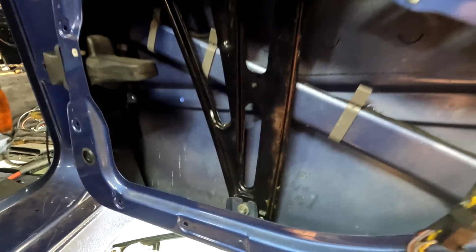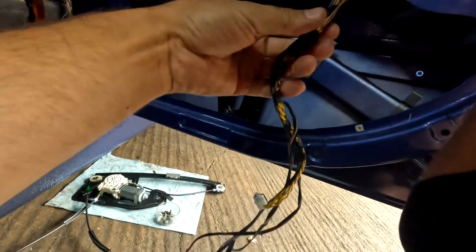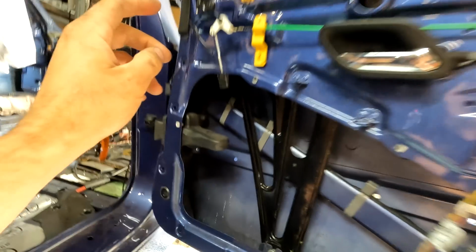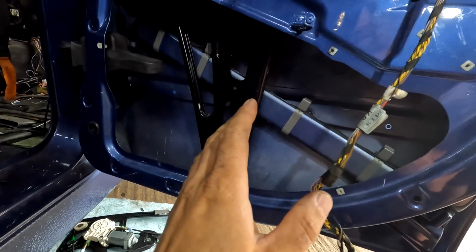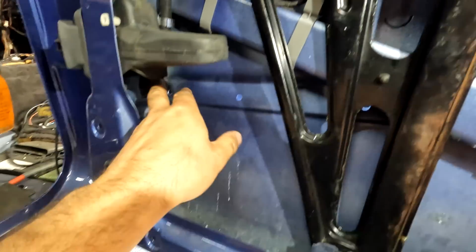To cut the long story short, probably no chance we're gonna install the illuminated exterior handle because the wiring is completely different. This one's got round pins, but the facelift got flat pins, so we end up staying with the pre-facelift door wiring. And we originally got DSP as well, so that's that. Yeah, everything as supposed to be.